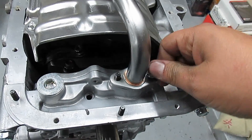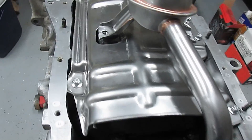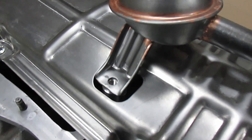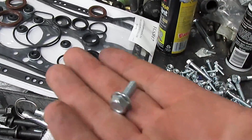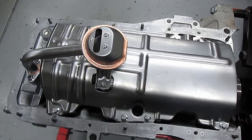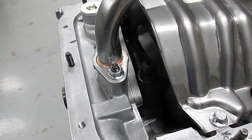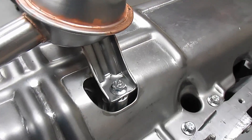Put this on — you're going to have half-inch screws, M6 by 1.0 by half an inch. Put those in the top of the pickup, and once again wipe off any squeeze-out. You shouldn't have any; if you do, you probably put too much on the gasket. Look at that nice hardware — so sexy.